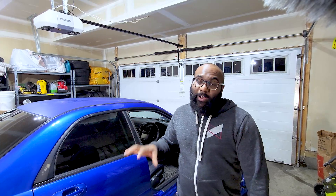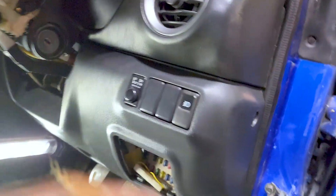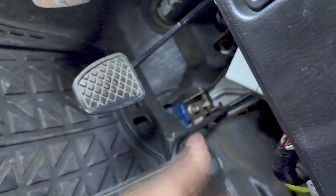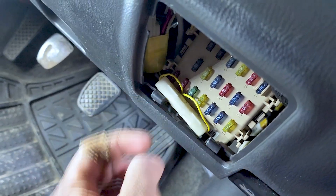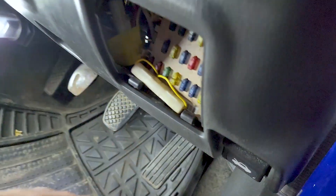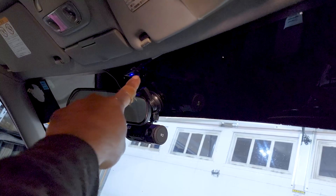Now let's take a look at how it is installed — the final installation in the car and how I have routed the Bluetooth module away from other metal objects to make sure I can connect to it easily. I got everything installed under the dash here. The control box is right here and I used some wire to hang it up away from the pedal so it's not interfering with anything. I have the power wire with a fuse exposed here so it's easy to get to in case I need to reset the setup — I can just pull the fuse and it will reset the system. I routed the wires for the Bluetooth module all the way behind the dash, up through the A-pillar, and you can see the Bluetooth module blinking away up there.